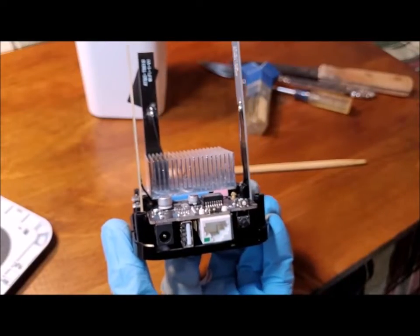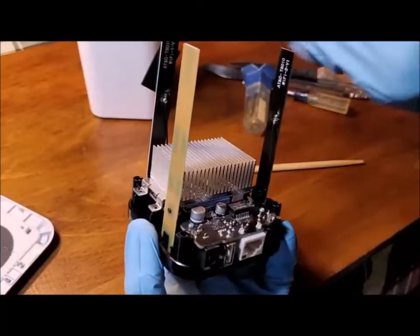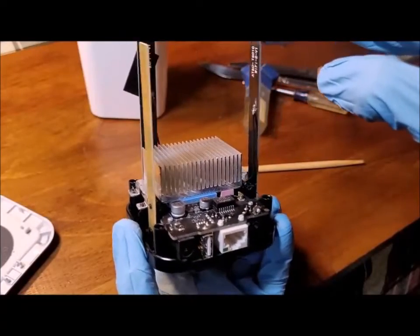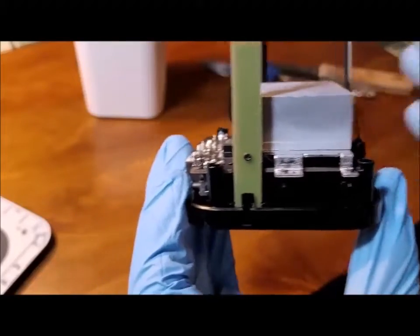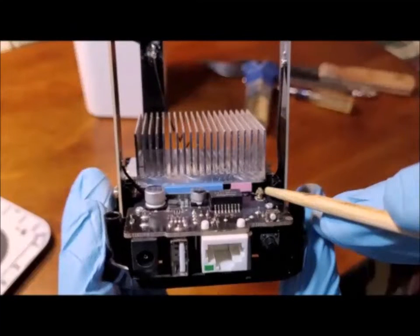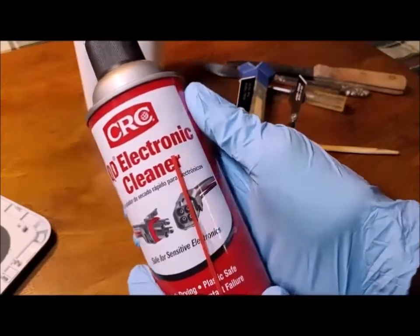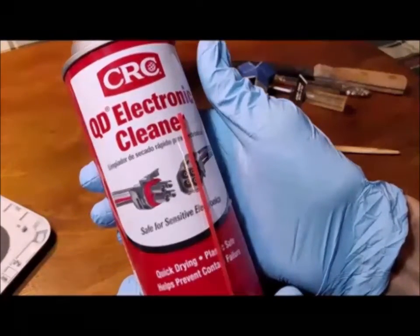The unit has three RF antennas, each connected to the PC card by a single black wire. As I traced one of the wires to the PC card, I immediately found the likely cause of the Wi-Fi loss: the use of miniature compression connectors. These connectors probably help expedite assembly, but can fail when their contact surfaces become oxidized over time. I used a common electrical contact cleaner to break through the oxide buildup.